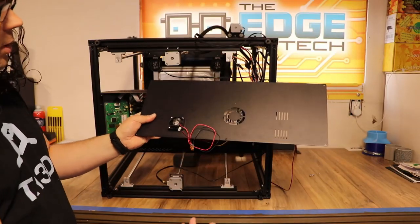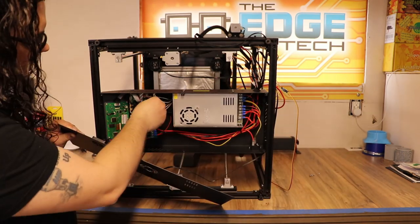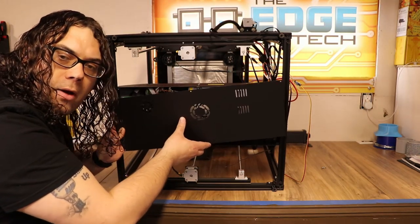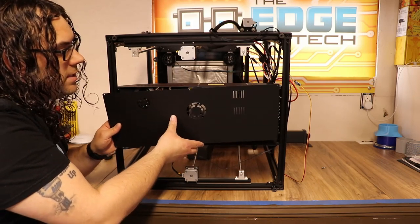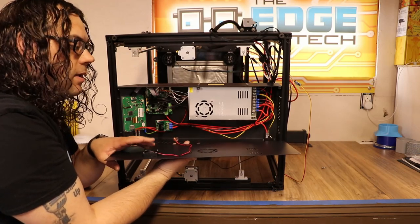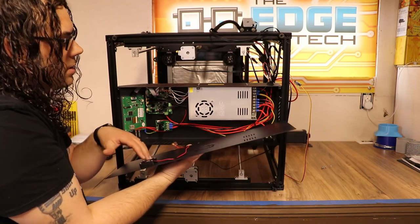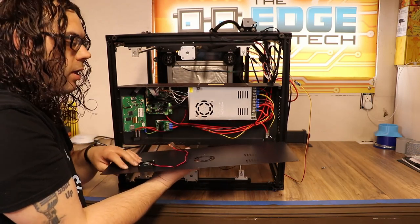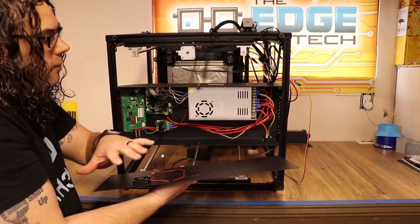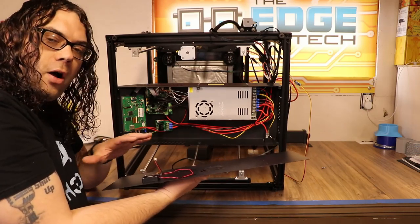At this point we can take and put our back panel back on. When you put the back panel on, plug this back into the board where it came out of and put the six bolts back in. But what I want to do is actually go on to the second video in our series. If you just wanted to learn how to replace a fan in the case, we just did that — video's over, you're good to go. The next video in our series is going to be replacing the power supply in the Ender 5 Plus. The third video will show you the final results of all the upgrades we did.